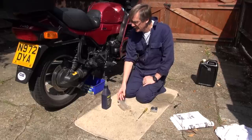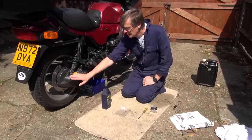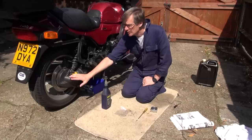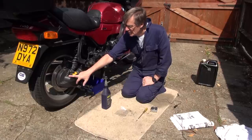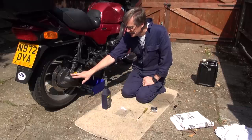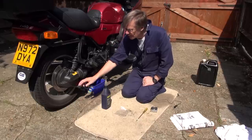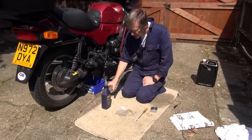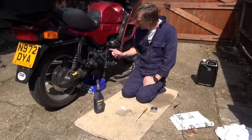There are two washers left and two areas on the bike that still have oil needing to be changed: the final drive and the gearbox. This is a shaft-driven motorbike. I'm not going to change the oil in the final drive — there's a weakness with BMWs where the wheel is only supported on one side by a bearing, and they tend to knock out the bearings. I lost the bearings in the back here less than 2,000 miles ago, so this back end has been rebuilt with fresh oil. If you had to do it, there's a filler plug and a sump plug — drain the oil, put the sump plug back in, and fill until oil just reaches the top threads of the filler hole. You need EP80/90 gearbox oil in both the final drive and the gearbox.